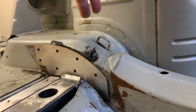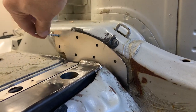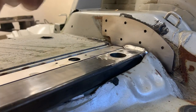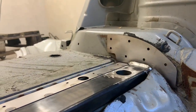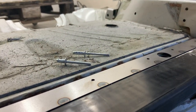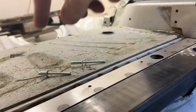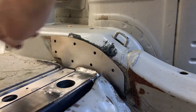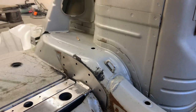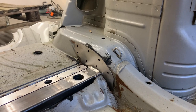If you feel a first layer that's fine, but if you hit a second layer that will be the metal vent tube - you do not want to drill through that. Also for the very front holes you will not be able to use the longer standard rivet I supply. I supply shorter ones as well: there are three short ones - you need two of those three for the front holes - and the rest of the holes use the longer rivets. This is very important because if you drill too deep you will drill into the vent tubes and have gas fumes inside your car.